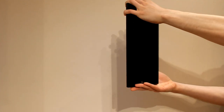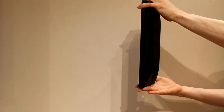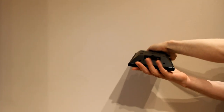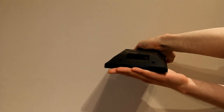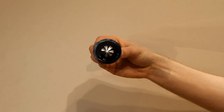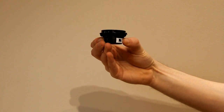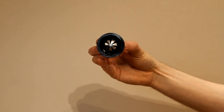The drive unit is just 27mm deep, and the fact that it fits perfectly into the cabinet aids with the cabinet bracing. You can see here the slim profile of the speaker and where to insert the cables into those small terminals on the back and bottom of the speaker. You just need to use an allen key to unscrew those terminals and then push your cable in — that's for wall mounting or if you're using the stands. That's where the selector mount system plugs in. It's a side-vented one-inch tweeter using a tangerine waveguide to smooth out the high frequency response.